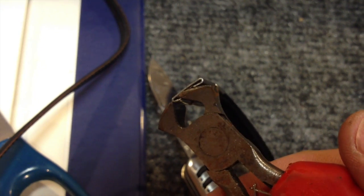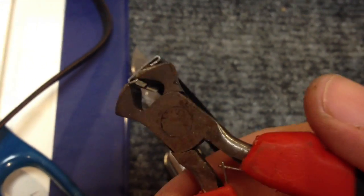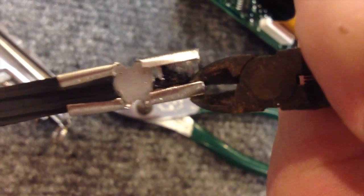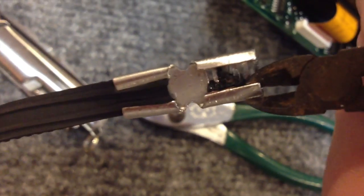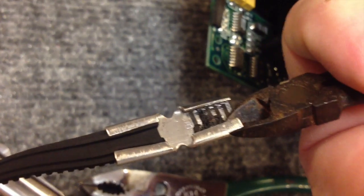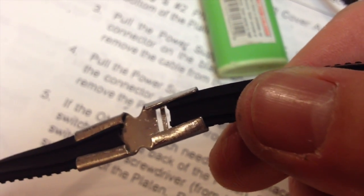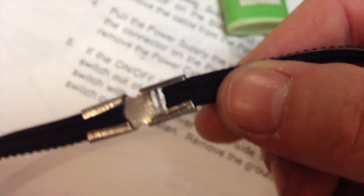I had to figure out a way to separate the crimp without tearing my fingers up. Just get your four-dollar Home Depot mini nippers and carefully — without cutting — use them to get in there and open up the crimp. You can also use small side cutters to start opening up the end and work your way in, then switch over to the nippers for the full opening. The first side is ready to go — the trimmed end of the belt is going to slip right in, I'll crush it closed, and we'll be off to the races. But first, let's make sure it's not twisted or looped the wrong way before we commit. The belt is all aligned with no loops — we're ready to crimp.